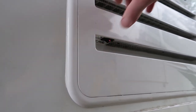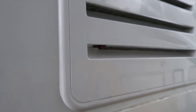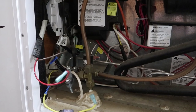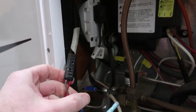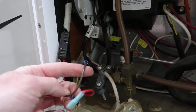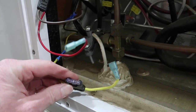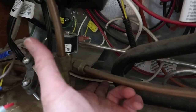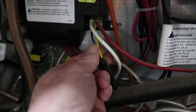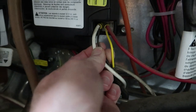On my lower vent I have a switch that controls the light. The wire comes up right along the side here, and I've got a little disconnect plug. The wire for that switch is tapped into the refrigerator power. Here's how I did the wiring on the light: this little pigtail with a two-pin connector — that wire goes up to the light. This is our ground wire; it goes directly to the light. The red wire connects to one side of the switch, and I have a small fuse. The yellow wire goes to the other side of the switch, and then both of those wires come together routed back behind. The yellow wire piggybacks into the red — the positive for the refrigerator — and then the black piggybacks into the white, which is the ground for the refrigerator.